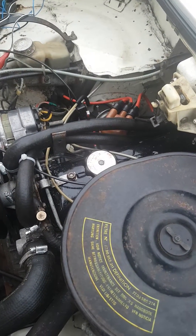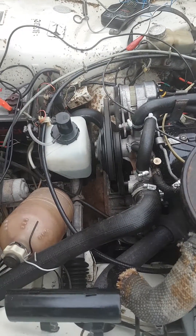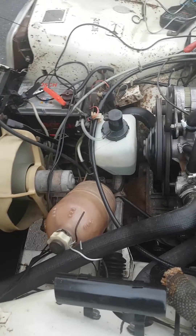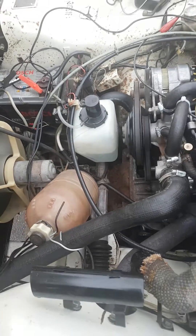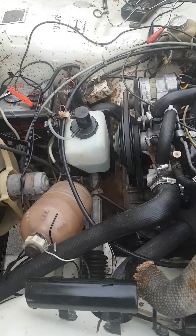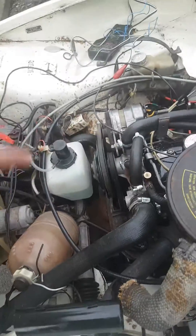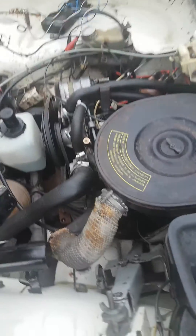With the vacuum pipe removed, it has no effect on the advance whatsoever. The other important thing is to only check tuning aspects when the radiator fan isn't on. That way you get the true engine speed. With the fan on, there's a little bit of resistance on the alternator which can turn the engine slower — as you'll hear the difference in tune.